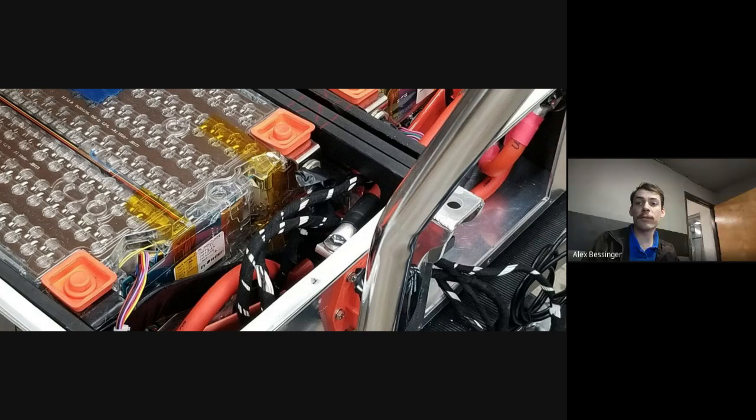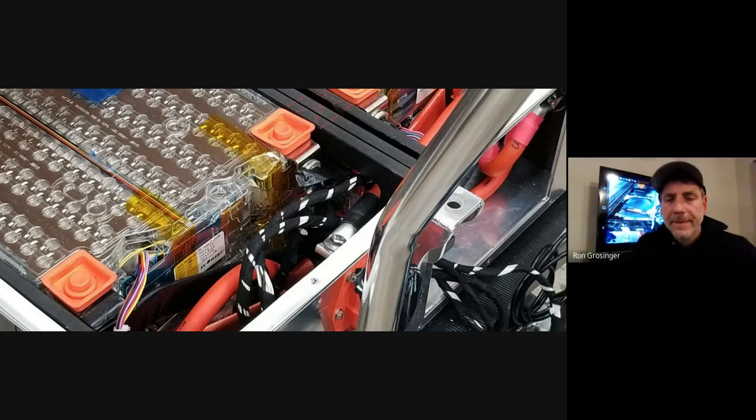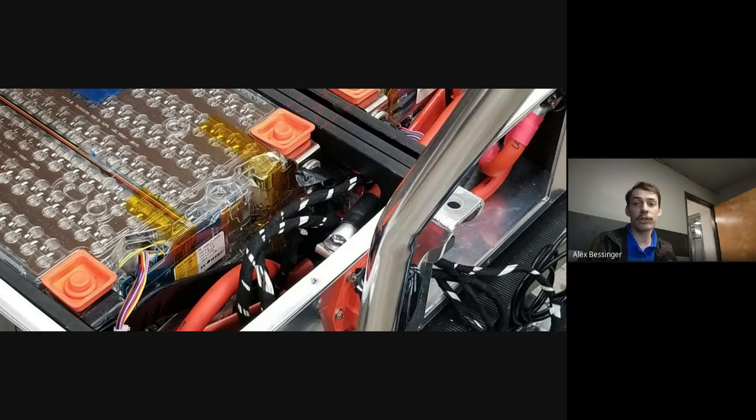Right. A lot of off-the-shelf systems that you can buy run a lower voltage, like the Hyper 9 motors and a lot of the brushed motors, AC, your HP EVS like AC50 and that kind of stuff, they're in that lower voltage range, right? Your 100 to 150 volts. But once you get into running something like a Tesla drive unit, you have to run those higher voltage systems where you're in that 300 to 400 volt range.